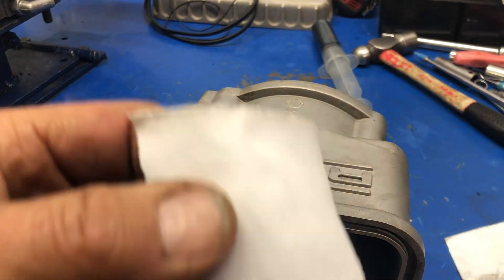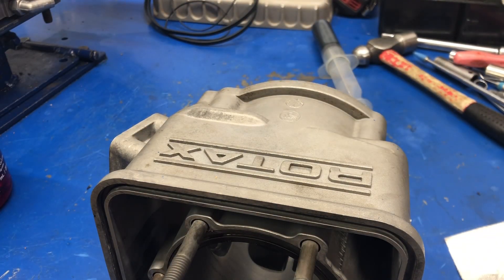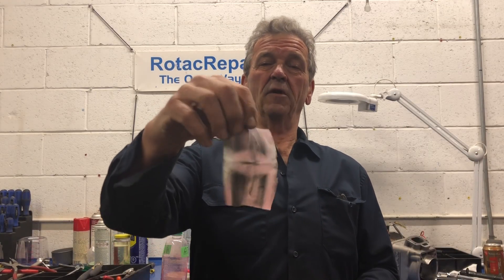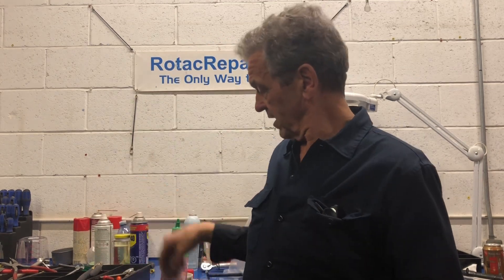All right, so I just finished this one up — clean, nice. I've been a few minutes doing this but it's well worth the time and effort. The very first one we started with picked up a lot of microscopic dirt. Grit can be from the honing stones, and it can also be microscopic little chunks of the cylinder metal itself. None of those things we want going through the engine.